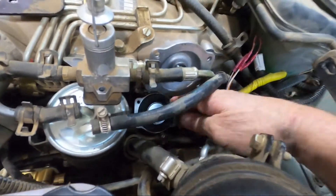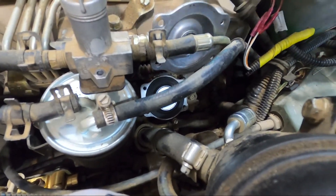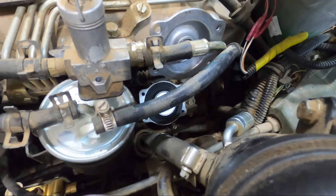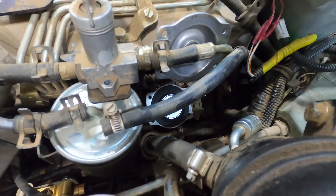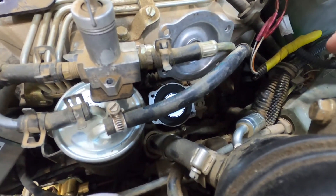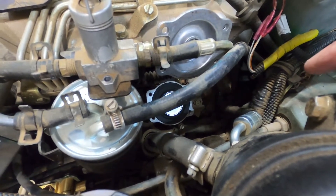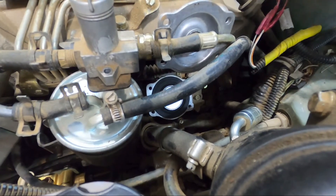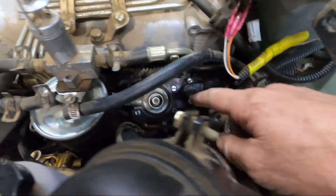I took it apart just to make sure my diaphragm was good. Fortunately mine is nice and soft and feels really good. But in 5 to 10 years down the road we're going to start seeing a lot of these Growlers with this diaphragm going bad depending on heat and other factors. I think it's a common part — you can buy these parts out of Brazil and I believe the Cummins 4BT uses a very similar pump, so this might be the same diaphragm, though I haven't compared parts yet. I don't think it's going to be a problem getting them when the time comes.